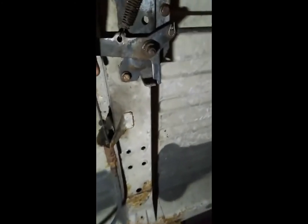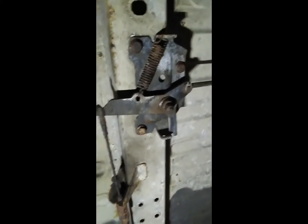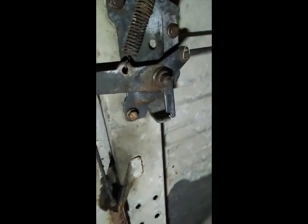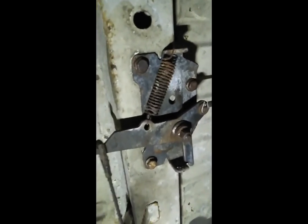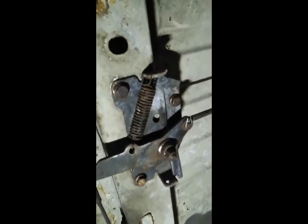The cables are going to be greased — everything's going to be greased again, actually. When it's completely finished I'll go over it again. For all you eagle-eyed mechanics out there thinking that copper slip was very watery when I put it onto the swivel in the vice — that's my own recipe. That's copper slip with a little bit of engine oil mixed up and put on with a paintbrush. I've been doing that for years and it works really well.